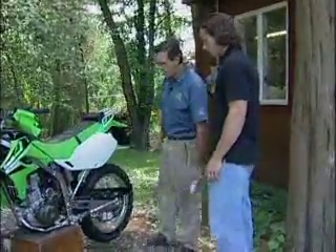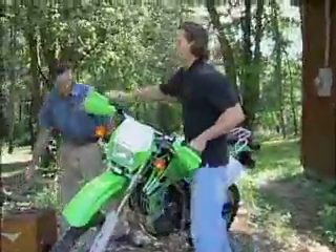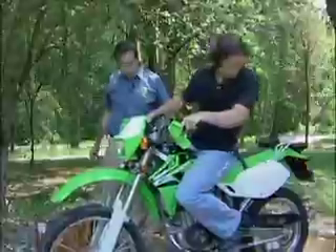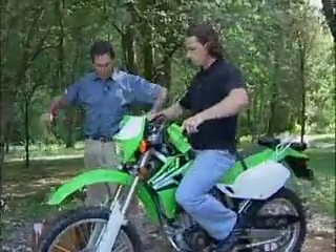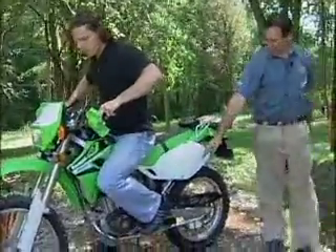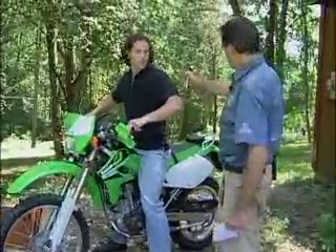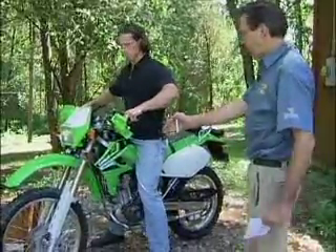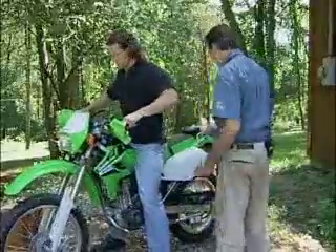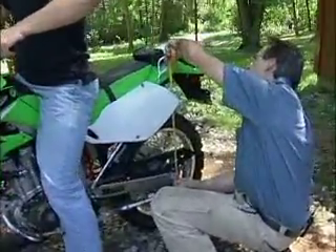Once you get on the bike, I'm going to instruct you how I need you to sit so that we get an appropriate measurement. We want you to slide your torso all the way to the front of the seat — all the way forward — arms bent. If you look down and you can see the crossbar on the top triple clamp, that will put you in the right position. We also want both feet on the ground, just enough weight on your feet to balance the bike — basically as much of your body weight on the bike as possible. This way his body weight is distributed pretty well equally between the front and rear. We want to set it with you pretty much in the middle of the bike, which is a standard turn entry position. I'm going to take my second measurement and we got 500 millimeters.